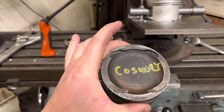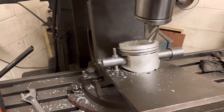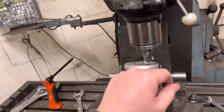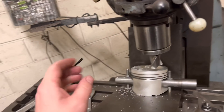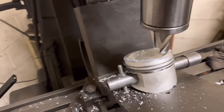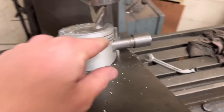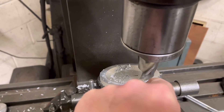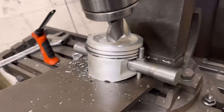What we do is we set up the inlet side first. We get our cutter which is the right size for doing this - this cutter is slightly bigger, a couple of mil bigger than an inlet valve, and that's the way I like to do it. I've already put one pocket in here as you can see. What I do is go from the highest point and go five mil down - that's how deep I do my pockets, and that's more than enough.